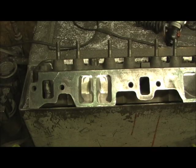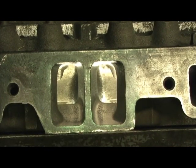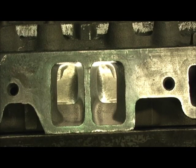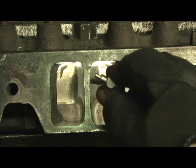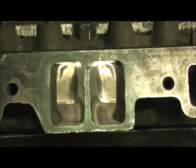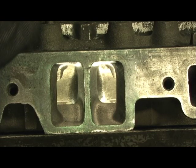For this part right here, all the porting and blending is pretty much done, as you can see it looks like it's layered in there pretty good. Sometimes you can actually tell the parts that you need to touch just by looking at the reflection in the light. Looking through the viewfinder right here you can see this a little bit — that's actually a reflection of light. But if you run your finger across it, it feels flat. If there's a rise it might be at three or four thousandths, but it's not much.